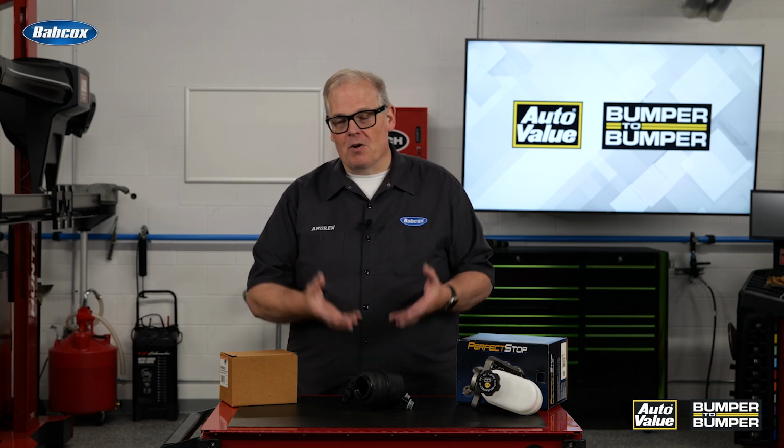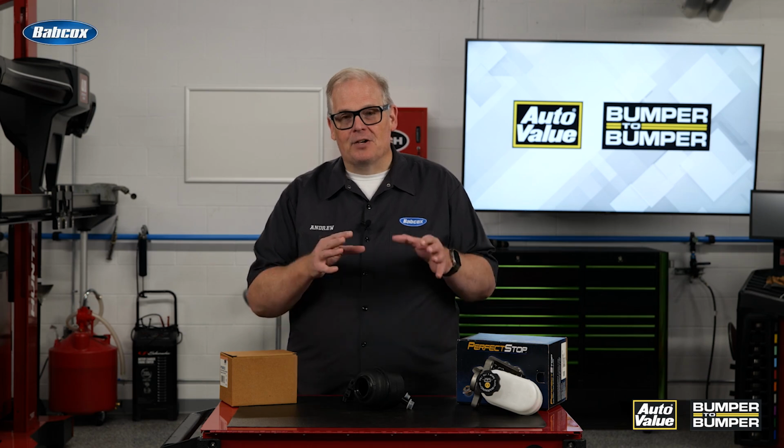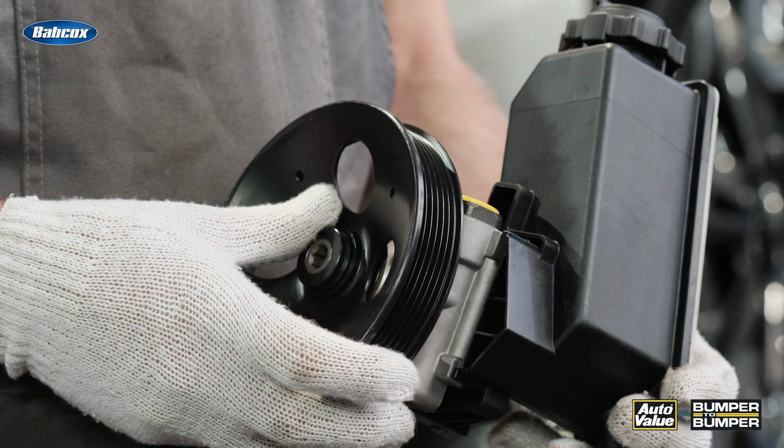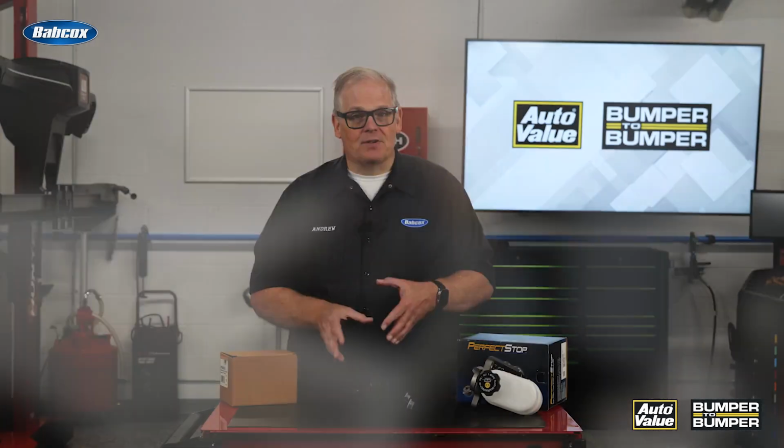So when you go and fix the power steering pump, but you don't address the reservoir, there could be debris and contaminants that could go through the new pump or a very expensive rack. These are very simple items to replace, but they can make a complete difference on the job.